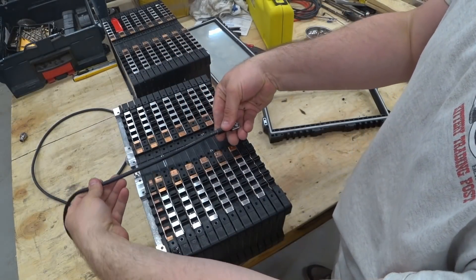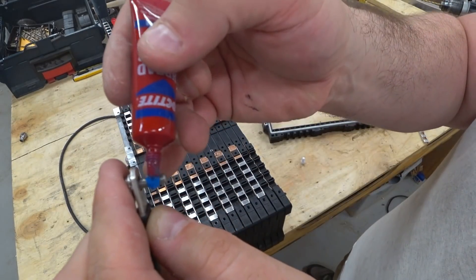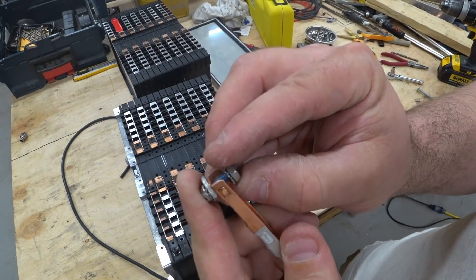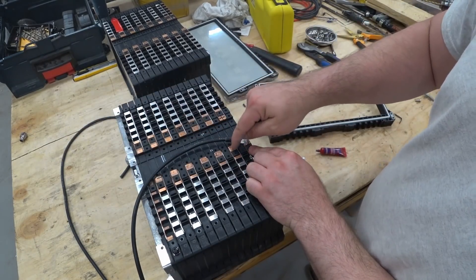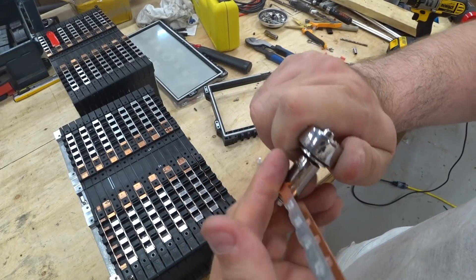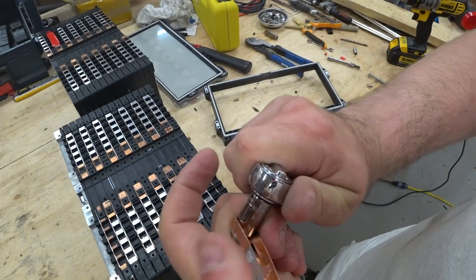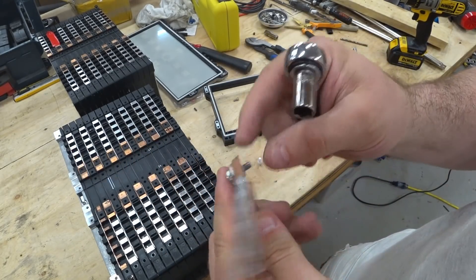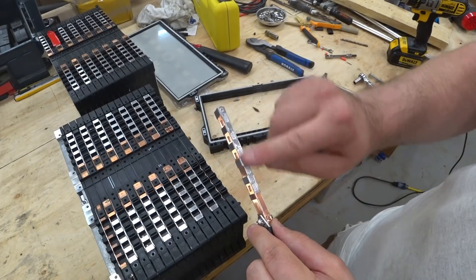Here's our wire. I want the wire to go off this side. I'm going to go ahead and put some Loctite on here. And now with Loctite on those threads, I'm going to thread on this little nut. I'm going to adjust this so it goes off to the rear, but I don't want it to be on top of this next bus bar. I bent the bus bar a little bit as I tightened that up, so I'm going to have to be careful of that. This strip here is going to have to be spot welded back in place, so I'm going to sand this down.